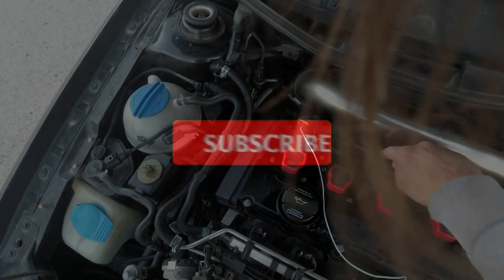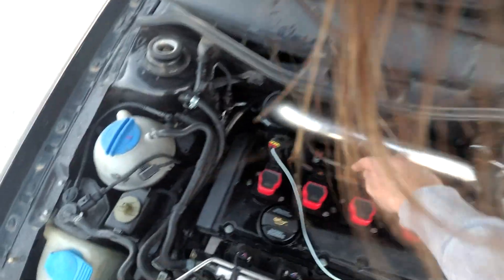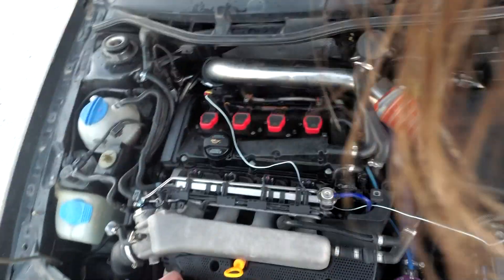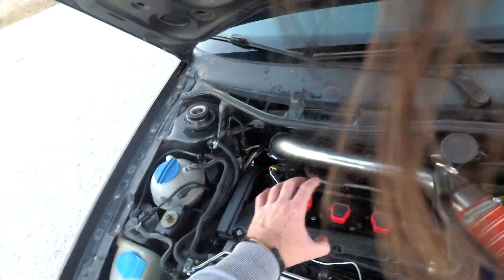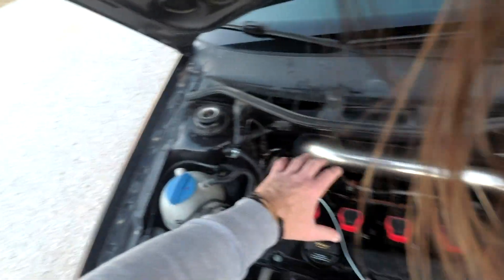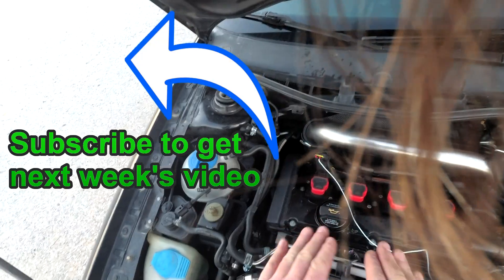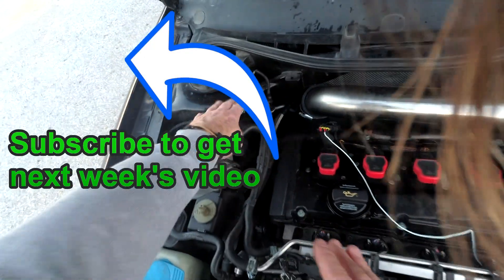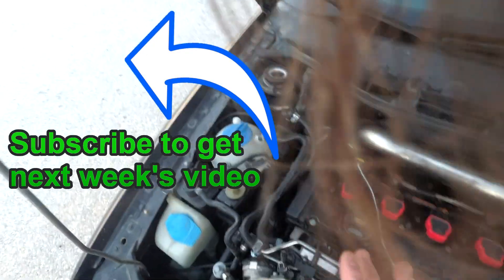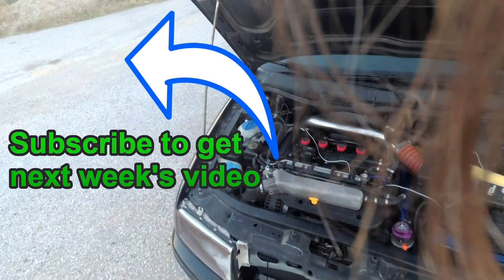I've got no heat problems using this cable routing sleeve. All the wear is going to go into the plastic and not into the component it's rubbing against. I would not recommend this sleeving in a place where there's a lot of movement — for example, where the engine is moving and it's connected to something rigid, like a washer bottle or these hoses here. There's only one solution to that: make sure that the cable itself does not touch.